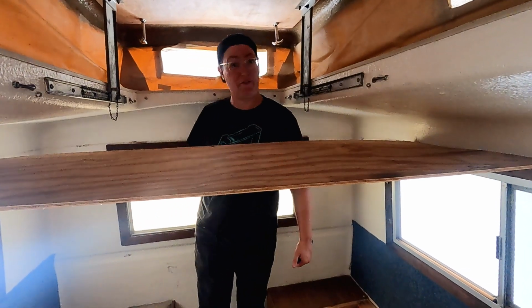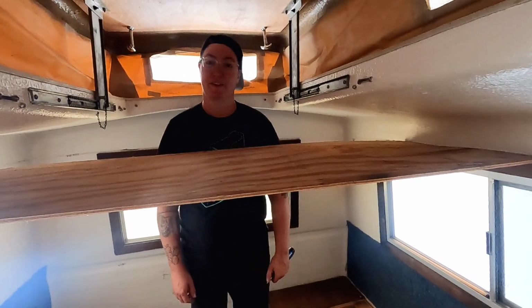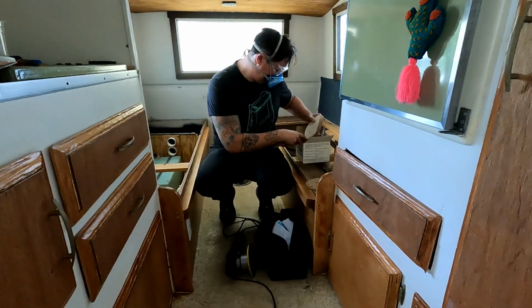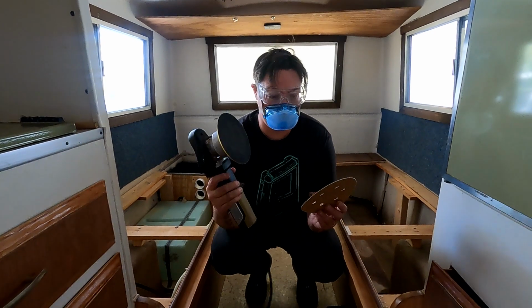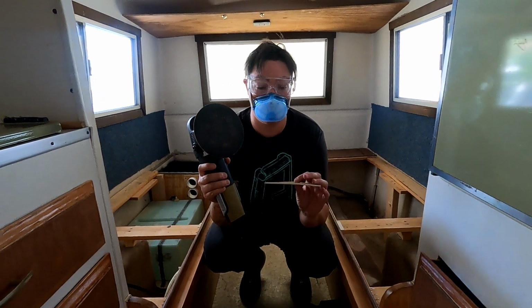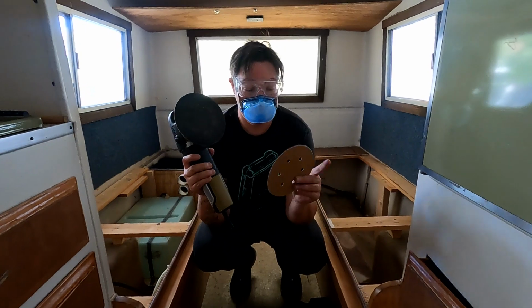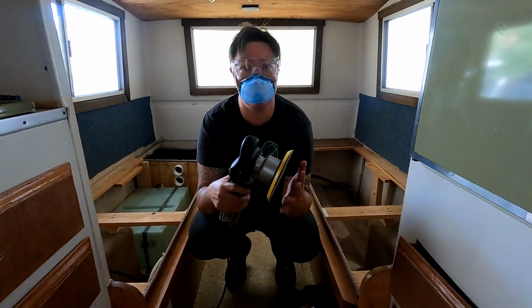But now we're gonna do a frame at a time, I think, of sanding. It might be a little bit more slow going, but of course that's the way projects go. I'm using 80 grit sandpaper. This is a buffer, and we can put the link down below, that I used originally to polish Wendy, but we've also used it to sand down everything. So I got these 6-inch discs, and we can also put that link. And it's been a really great multi-purpose tool, which I love. So here we go.